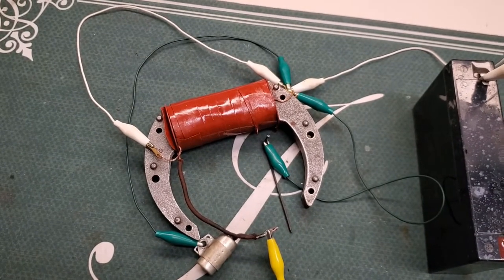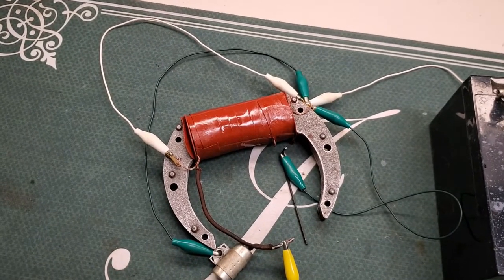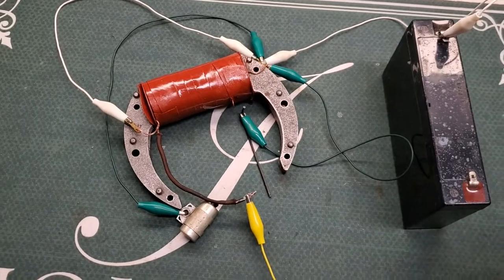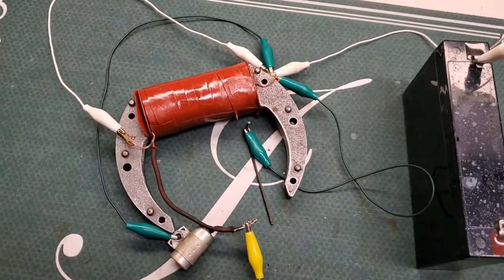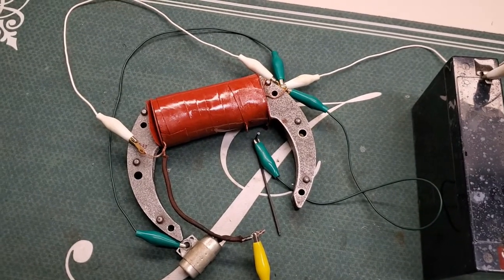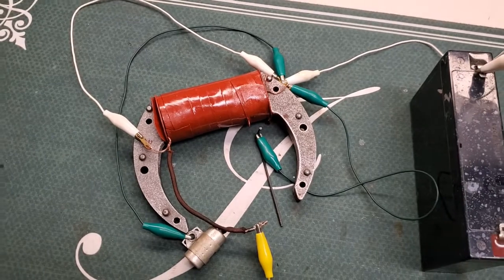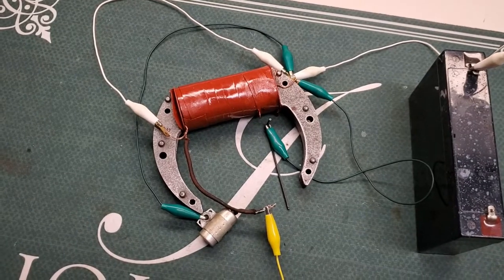I did notice on this coil, for some reason, and I think it's because maybe it's a later date, like I was saying earlier, I think all the parts in this coil are actually aftermarket, or from later on down the road. Original Briggs, early Briggs coils of this style usually run about 2.5, 2.7K. This one's running 6.8K, or 6,800 ohms. A lot of newer coils actually run that high resistance on the high voltage winding. So anyway, as you see, she works great. I'm going to go ahead and put her on the motor and go from there.